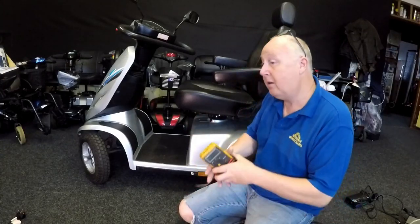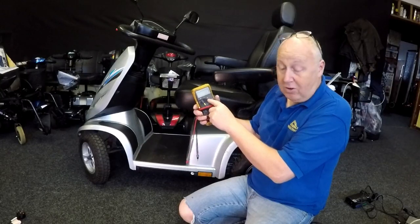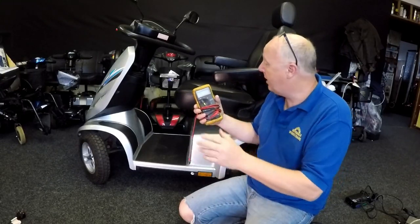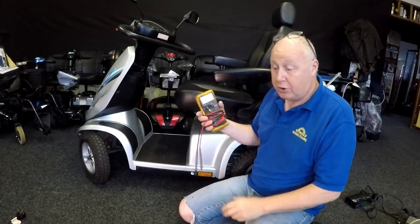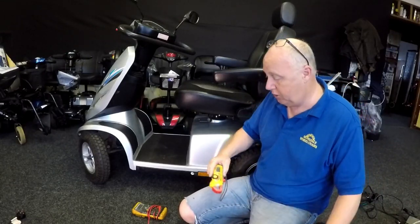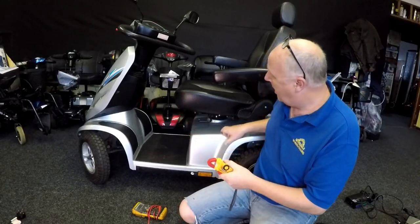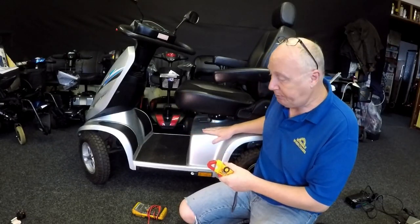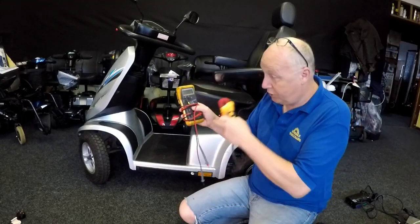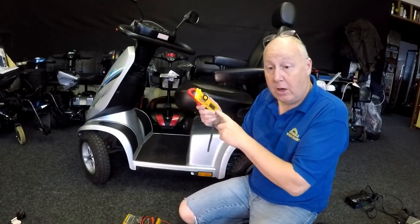The tools I use: a multimeter — put it to DC voltage. That's alternating voltage you have in the house, AC voltage, and that's your DC voltage — that's what you need to test the system here. And of course continuity if you've got a fault. But we don't do any faults today; we're finding out if it's charging to see if there's an issue. I also use a current clamp meter — a DC clamp meter. I clamp that over a positive or negative terminal on the battery, which is underneath the rear shroud, and that will tell me how much current the charger is actually putting into the batteries. And this will tell me how many volts the charger is putting into the batteries. Sometimes you can get these combined with a volt meter and a DC current tester as well.